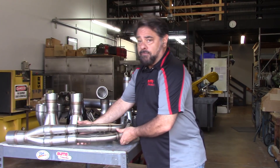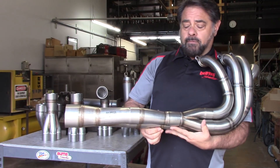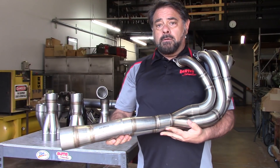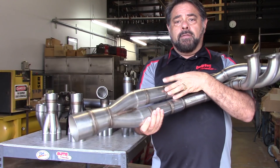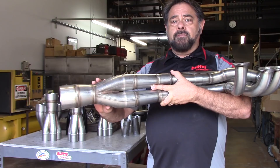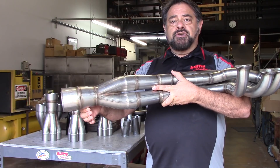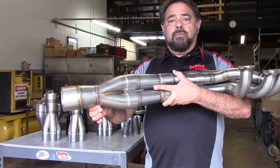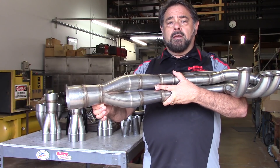As we return to our 4x2x1 or Tri-Y exhaust system, we see that we've got, in this case, one, two, three collectors — therefore a Tri-Y collector. This collector here is a parallel entry collector. We go down to what we call the collector outlet or throat, then to a transition, and then to a larger tailpipe size. The purpose of this collector throat is to try to broaden the power band of the exhaust system.